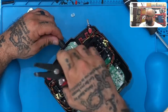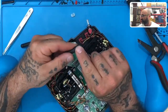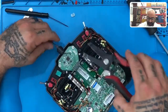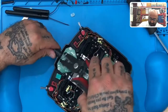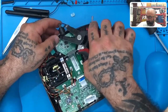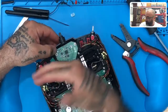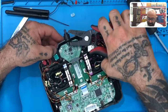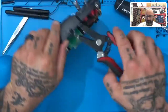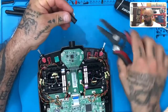Now here's the tricky part. The new antenna has a lip with a clip here, so when it pops in it locks open. To get the old one out you have to squeeze that clip closed — and be prepared, it can break. What you're trying to do is take one end and push it in while you push up on the edge. Once the clip has been released a little bit, you can just work it out with the pliers.